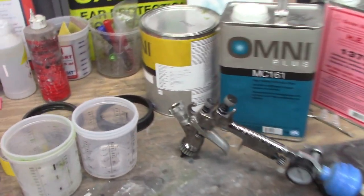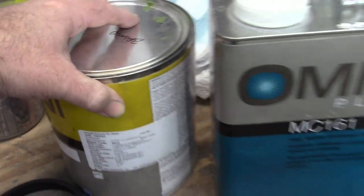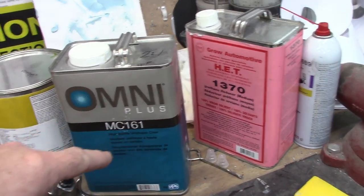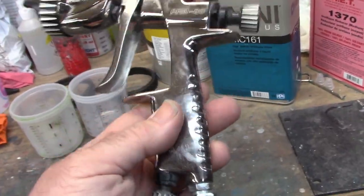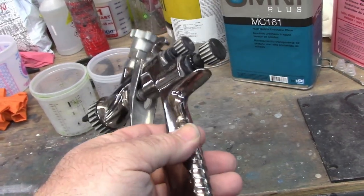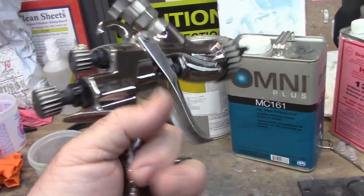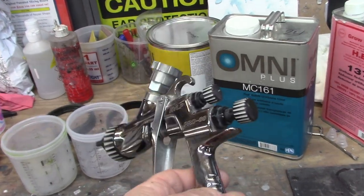So for materials, I am using PPG Limestone Green, brand code 2412, and I'm using Omni Plus clear coat, some HET reducer, and I will say, I've been using this gun right here. This is the HVLP Pro 88 Master HP Pro Series. I picked this up about a month ago because I was a little concerned with some of the other guns that I have in my inventory, which are up here on the shelf. And this thing has done a fantastic job. I will post a link in the description below if you're interested in trying one of these. This comes with three different tips, the 1.3, 1.4 and the 1.8 tip.